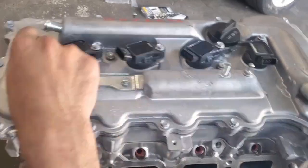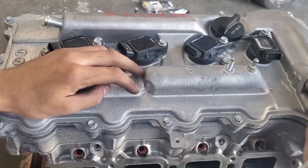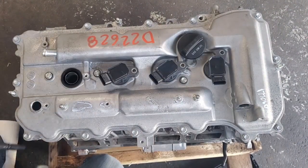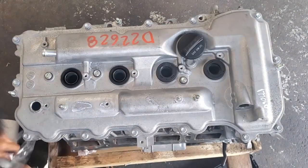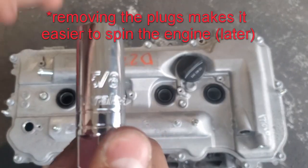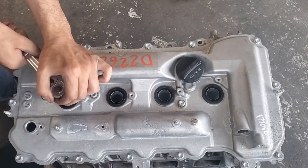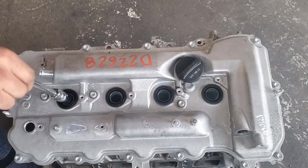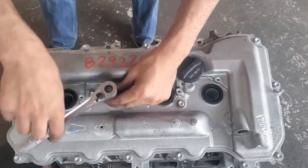After removing all the accessories, we can open up the engine. Notice I did not remove the flex plate, as I will have to hold down that side of the engine so that I can remove the very tightly torqued crankshaft bolt. All of the torque specs needed for the engine internals can be found as PDF documents in the description. If there are any extra specs that you need, a 2-day $20 subscription to TechInfo Toyota will give you everything you can think of. I also used it for the wiring harness diagrams.